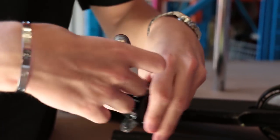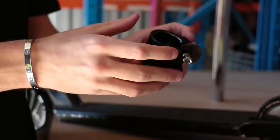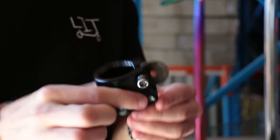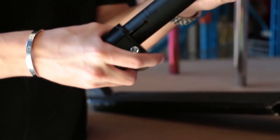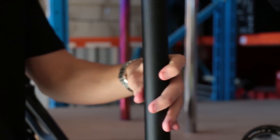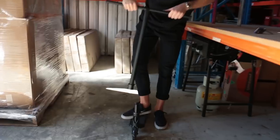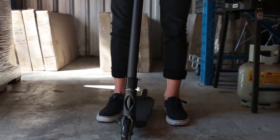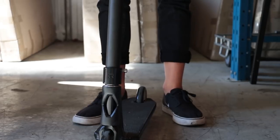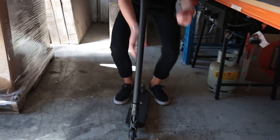Always do the bottom one and make sure the top bolt is loose so it can stretch the full way. I've just realized I stretched the top part — you can stretch either one but it's better to do the bottom one. Let's see if it works — easy. Before it wouldn't go on; now that we've stretched it the littlest bit, it's fine. Make sure your clamp is nice and straight before you pull the coin out, because the minute you pull it out it's going to be extremely tight and just stick straight to your bars.